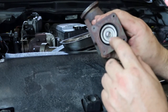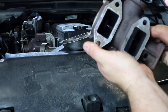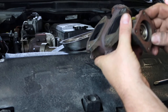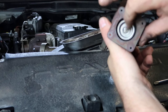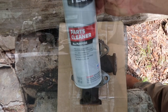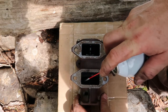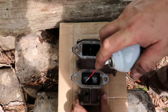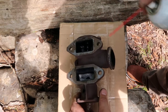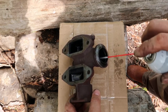In the end of here you have these two keepers right here and you have a valve in here that moves back and forth. What we're gonna do is go ahead and clean this out - put some cleaner in it and let it soak. Then take the two keepers out - you got a keeper, a retainer, and a spring behind there. We'll clean that valve real good. I've got parts cleaner that I'm gonna spray in here and work this valve back and forth. You want to let it soak at least an hour. Prop it up here so your cleaner doesn't run out.